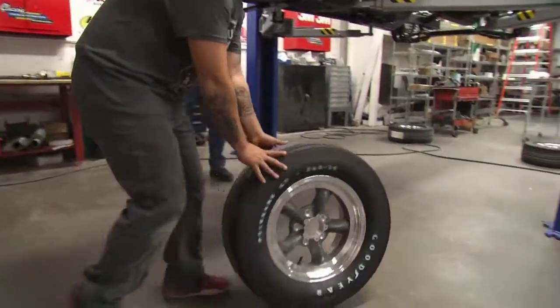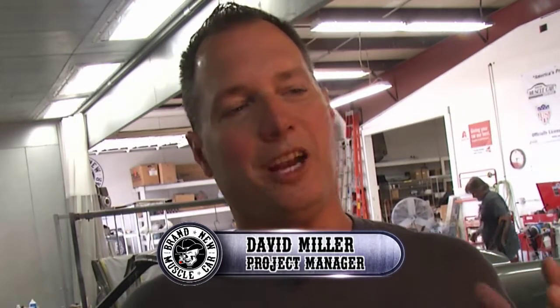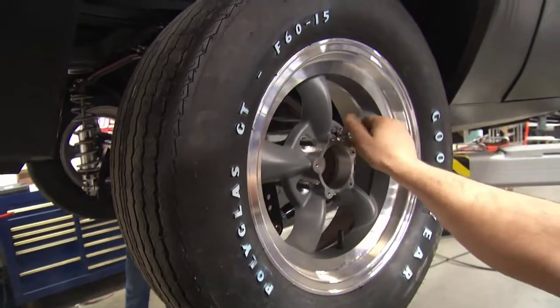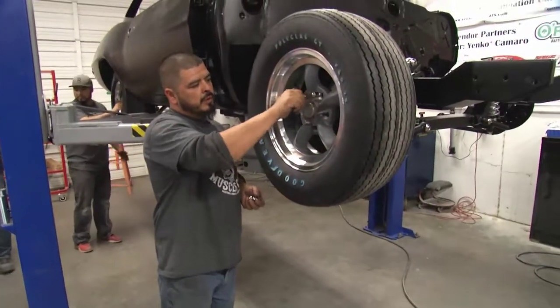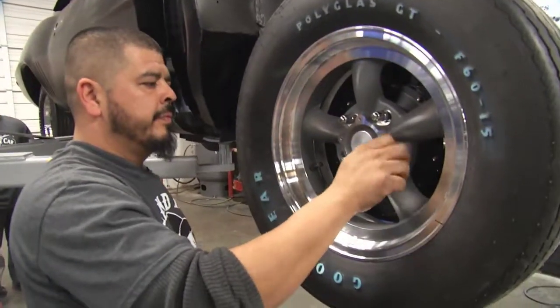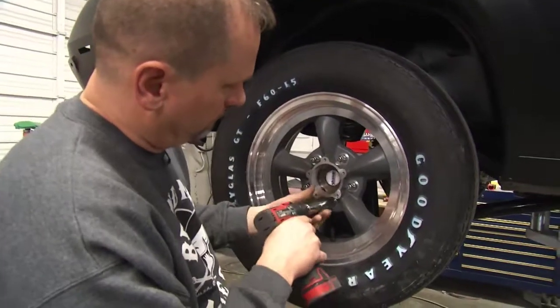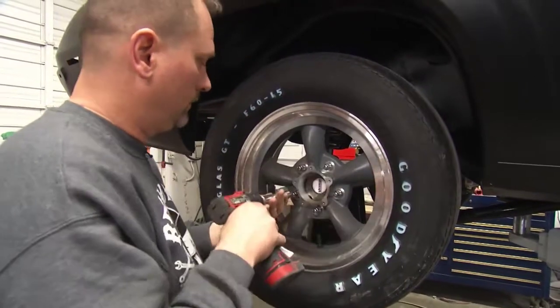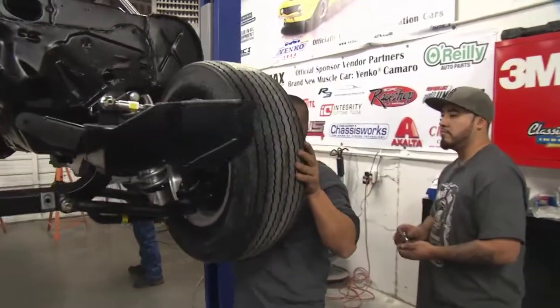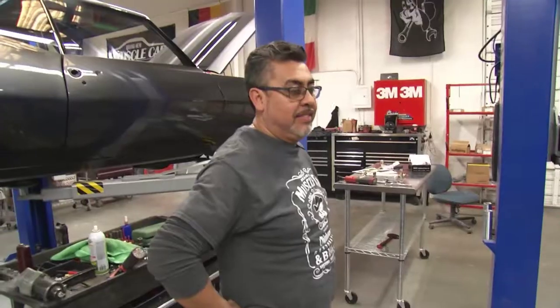"Time to put the shoes on, boys." In 1969, the Camaro had rally wheels and a couple of other factory options. Yanko wanted to make the car different, so he went with Atlas — a knockoff of the American Racing five-spoke wheel, a very classic design. American Racing still makes them, so Brand New Muscle Car called and had exact-match wheels made but bigger: 17-inch instead of 15-inch, and a little wider front and rear, allowing a bigger modern tire. "It still looks right, but it drives much, much better — much more grip surface on the tire."